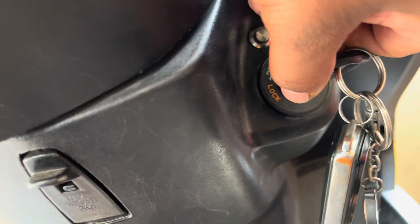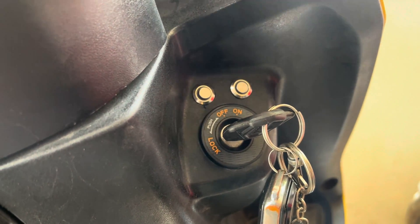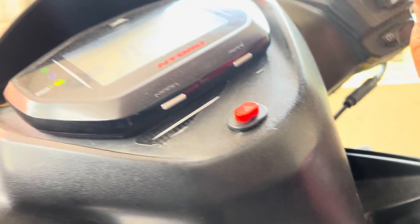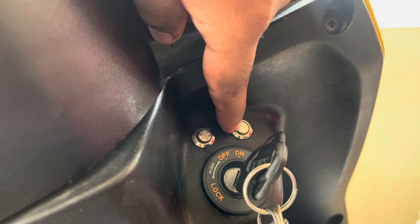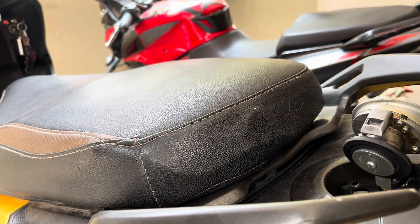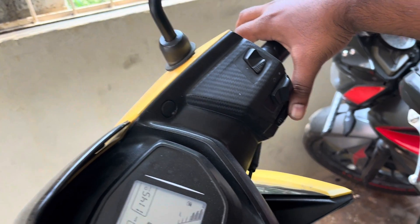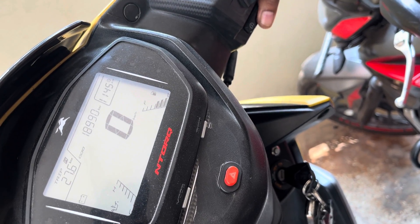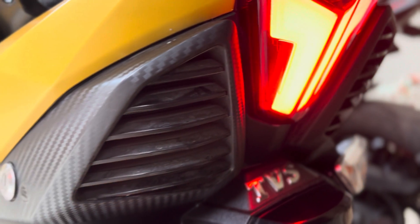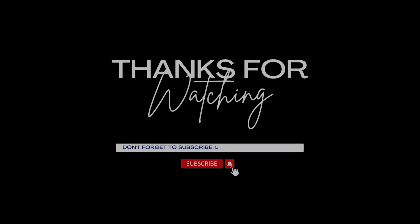Now let me again show you how this thing works. This button is used to open the tank cap and this one to open the boot. In the ignition off state, these two buttons don't respond as we have connected all the lines to work in the ignition on position. Now let me turn on the ignition — as you can see, now the bike is on. If you press this button, the boot opens automatically. By clicking the other button, the tank cap opens automatically, and the red light keeps blinking indicating that the tank is open. In this state, the system doesn't allow the engine to turn on, and if you accidentally click this button while you are riding, the engine shuts off automatically. I hope this video was informative enough. If you like the content that I make, please consider subscribing to my channel. Stay tuned for more such interesting content coming soon.